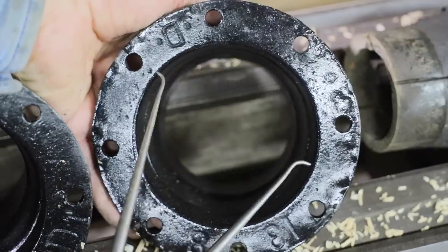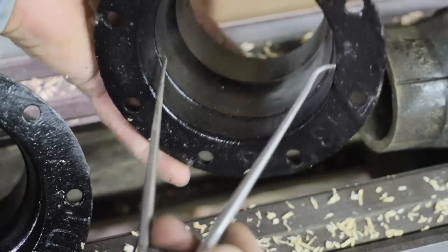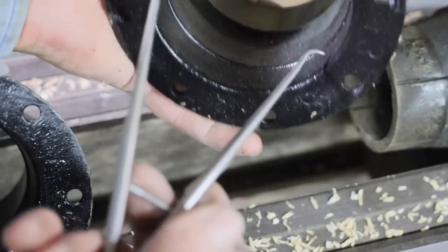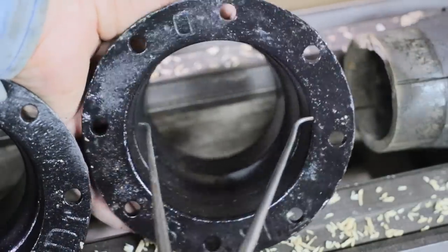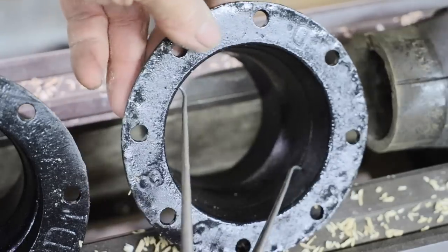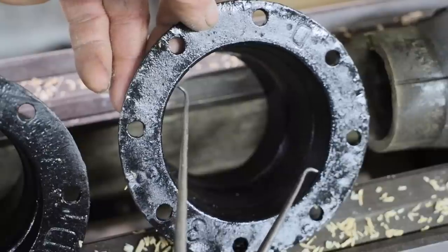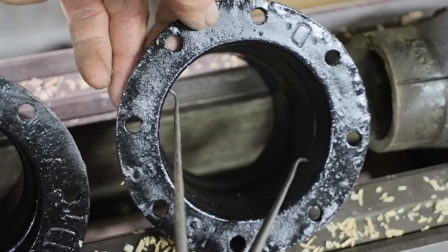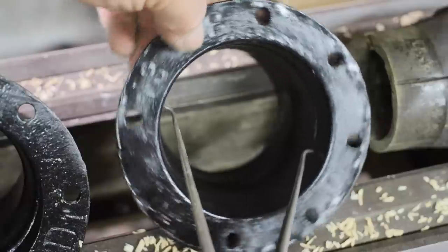The first place of contact is actually between the face of the spokes down to this first shoulder in the flange cast, and this is a taper. So I'm going to take that measurement and then I'll put a taper to the first area that's 5/8 of an inch long. This is equivalent to the hub band or the spoke band that's on a wagon hub. So you can kind of see the amount of difference there is in taper, but since these flanges are cast and not machined, sometimes you have to take the happy medium and take the average.